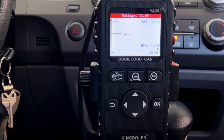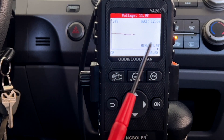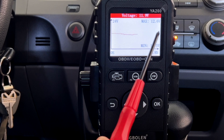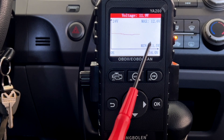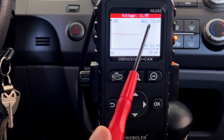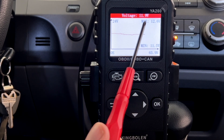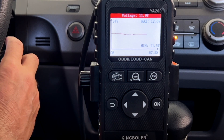Now, whenever you do electrical work, check codes, anything like that, you always want to make sure your battery's good. So if you start the car and minimum voltage goes below 9.6 volts, you need to check your battery, because most likely you're going to need a battery — it's not carrying the current it needs to carry. And on the same idea, your alternator needs to be above 12.6 volts; usually you'll see about 14 to 14.4 when the car is running. So let's go ahead and start the vehicle and see where that alternator ends up.